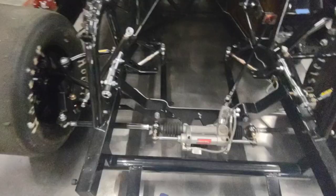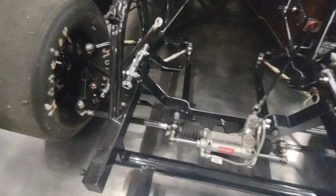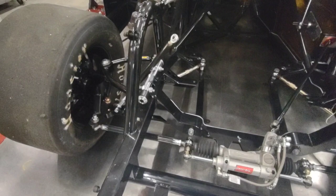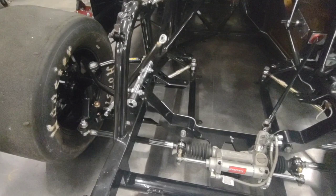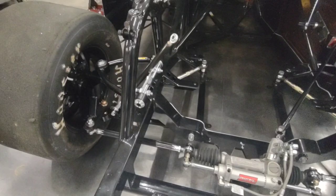I know this sounds like a tedious project, but your foundation is so important on your race car. Anytime the engine comes out of the car, I've got it back over here and I'm measuring it. Anytime the front end gets damaged, like if the right front tire gets knocked off, I've got this thing back over here and I'm measuring it. There's no sense in going to the racetrack and not being exact. And by being exact, the adjustments I make to the race car give me more feedback and let me know that was a positive change or it wasn't a positive change. It's a long process. You just gotta learn it. There's no quicker way to learn it than to start measuring stuff and recording that data.